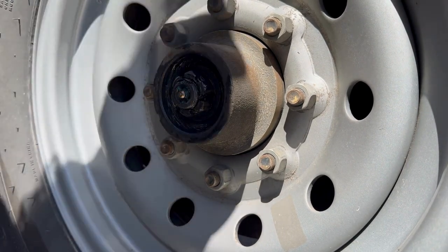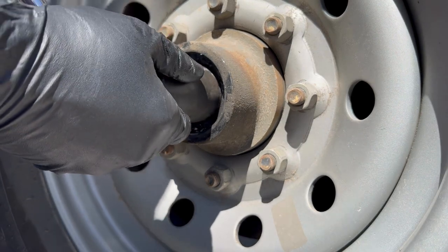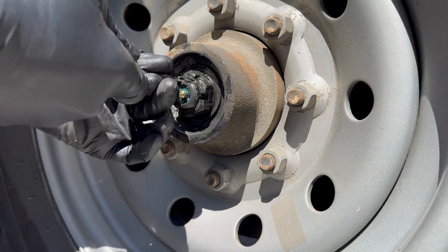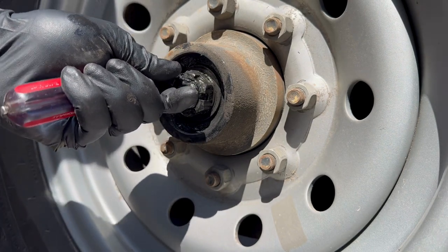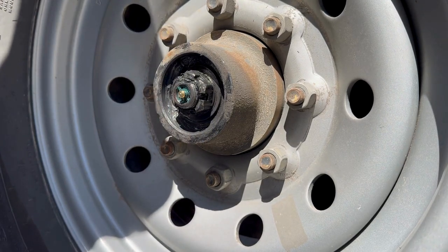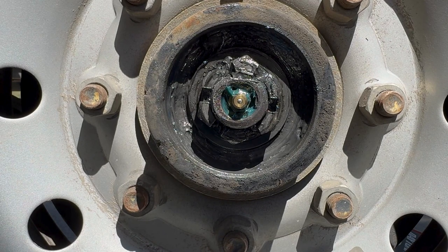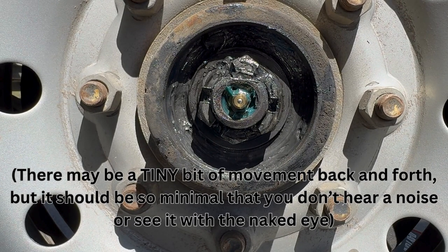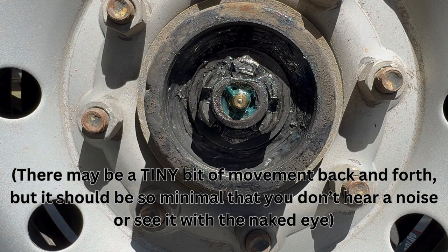As you can see, that play is gone. There's a bunch of debates on how tight to get this and the procedure to do. The way I like to do it is go until it's tight, go a little bit more, and then back it off until this flap lines up, and then push this back up in there. Now when we try to move this back and forth, there's no movement. It only takes a tiny little bit - you don't want to get these things too tight or they will eat your bearings, but you don't want them too loose either. It's a little bit of finesse - you've got to be right in the middle there.